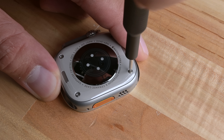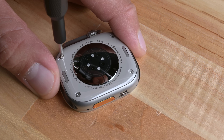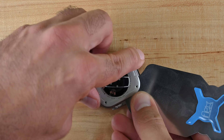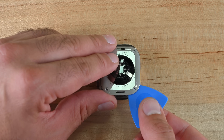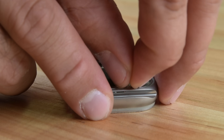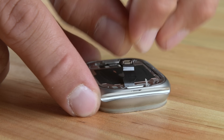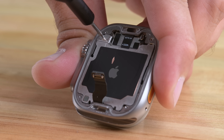There's a promising, if incomplete, step towards improved repairability here. For the first time the Apple Watch has screws accessible on the back — these are pesky Apple-specific pentalobe screws and the going isn't exactly easy once you get under the hood, but the fact that they're there at all is good news. It suggests a pathway towards enhanced repairability. The ceramic back plate comes away revealing not a battery. What is interesting though is this gasket — it behaves more like glue, and unfortunately it's destroyed the moment we take the back plate off, which means you'll need a very well installed replacement to retain the 100 meter depth rating. Removing the two brackets further confirms that this is not the way to the battery.